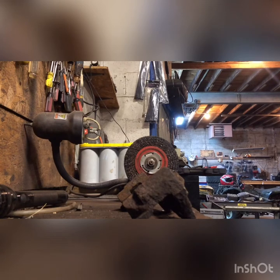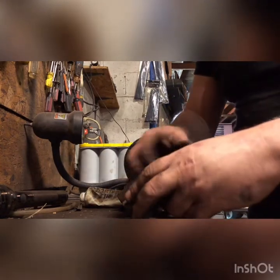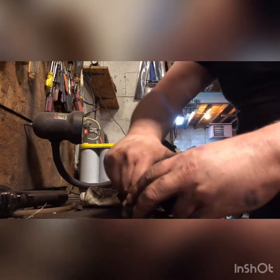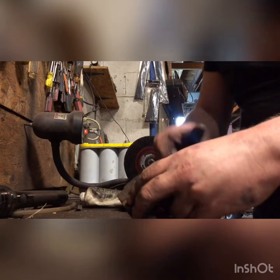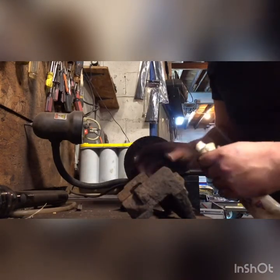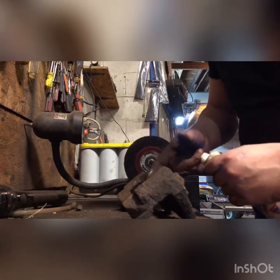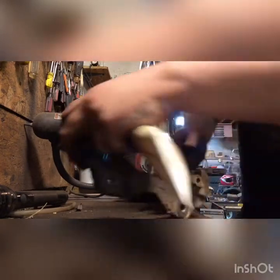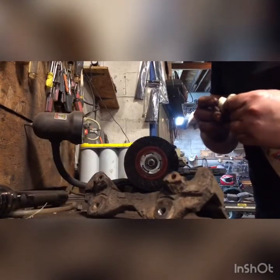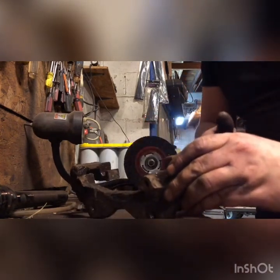Install pads when they're that rusty, the brackets. I don't think this caliper comes with a new bracket. But the reason the wheels were smoking could be the caliper, brake hose, or those pads were rusted up and jammed in. When you press down and the caliper presses in the rotor, it doesn't release because the rust locks them onto the rotor. Makes that rotor smoke, gets hot. Could be any of those problems we're dealing with today.